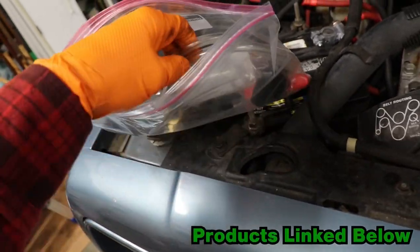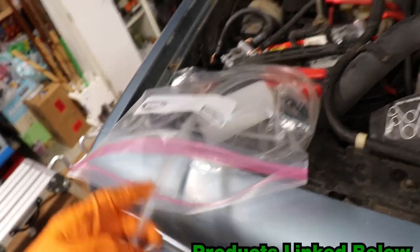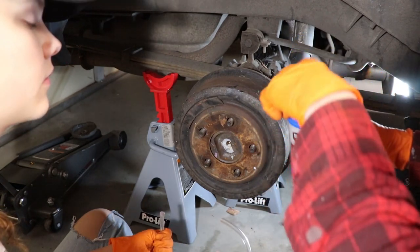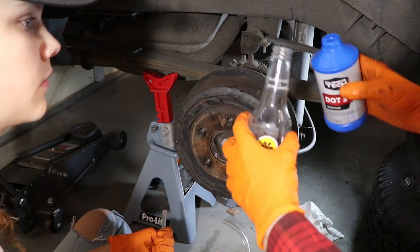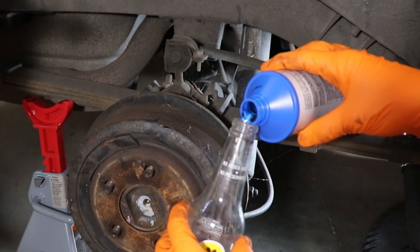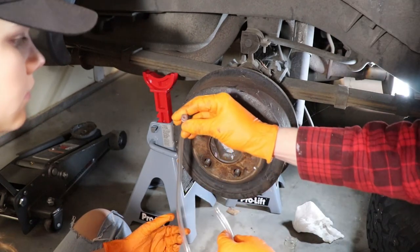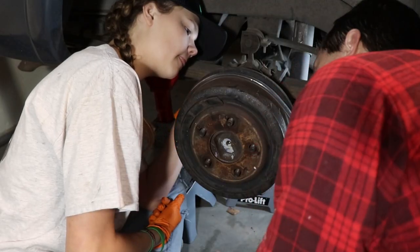Most people don't have this kit, but I will be sure to link it in the description. So we're going to take a glass bottle and we're actually going to take a little bit of brake fluid. You have to use new, clean brake fluid — not from your waste bottle. When you're adding fluid to your system, we want to use nice, clean, brand new fluid. Now let's find a wrench that fits over that little opening. Use the box end and place it over the top of it.